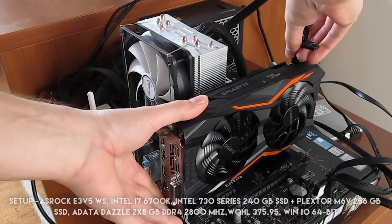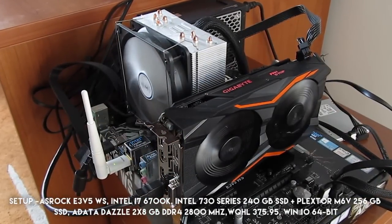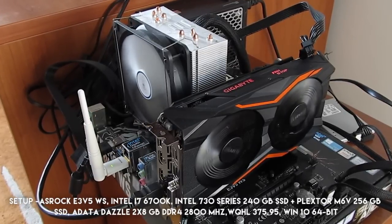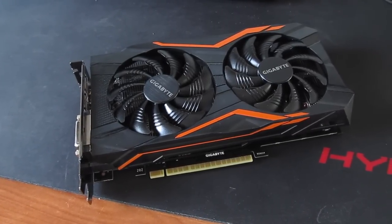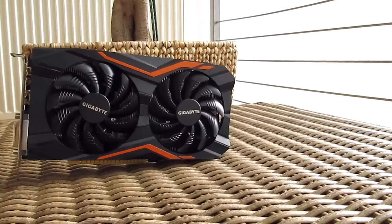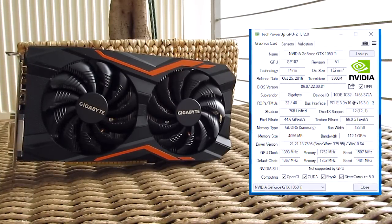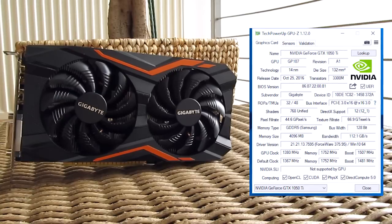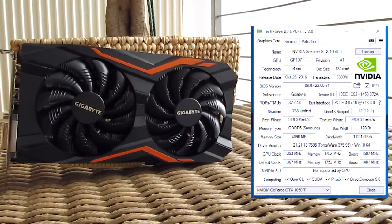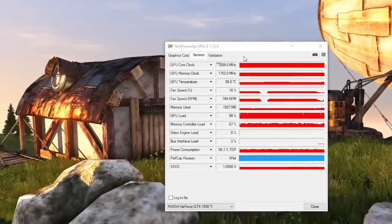Putting the card onto my benchmarking PC and turning everything on, I went in to check out its overclocking capabilities since this is my second encounter with the GTX 1050 Ti. The Gigabyte version didn't have any locked-in memory or GPU limits like MSI's, so I managed to pass 1911 MHz for the GPU and 2027 MHz for the memory, while factory overclocking settings were already decently high — over 1800 MHz on the maximum boost clock speed, thanks to Nvidia's GPU Boost 3.0 technology.